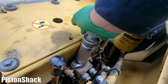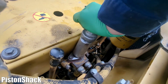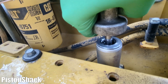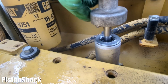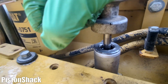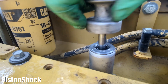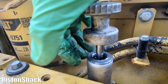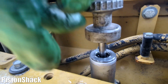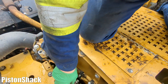There shouldn't be any air inside the fuel system on the low-pressure side. You can hear the hissing sound — air is there and fuel is splashing out when I'm pumping. That means we have a seal issue; the O-ring is not intact and it's splashing fuel out, which it shouldn't do.